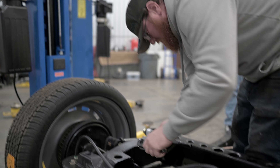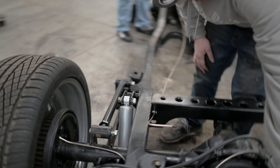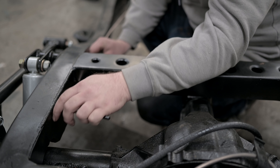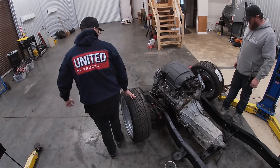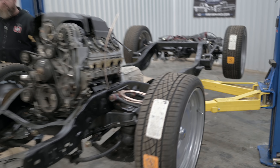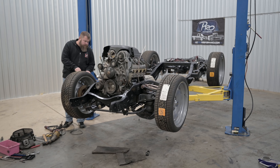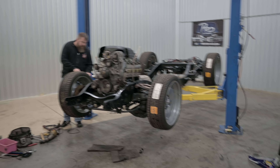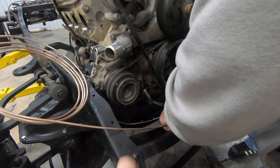Mike's bending this straight line all nice and neat. We're starting to run that quarter inch line up to the front — Mike's got a good bend going there. There's new brake line run toward the front all the way up the frame rail. We're using our new hoist in here so we've got this thing off the ground a little bit — makes it a little easier to work. Now we're running it across this front cross member instead of the engine cross member underneath.